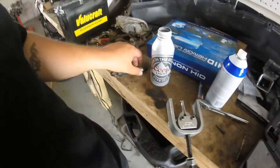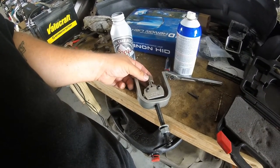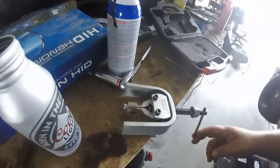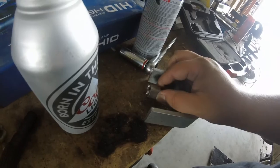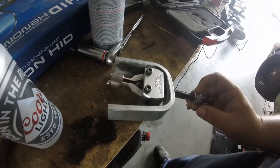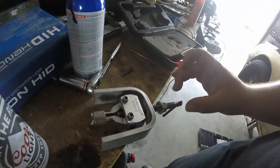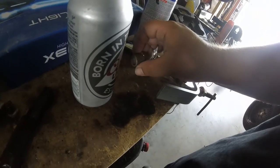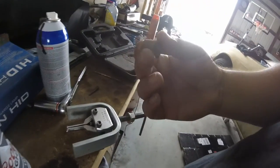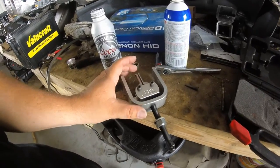Basically the way this tool works is it has these little claws that come together, and you insert it into the crankshaft where the pilot bearing is. It slides in inside and then you run this through until it's biting onto it. Then you run down this nut and that gives you the puller action, and that's what pulls the whole thing out. Hopefully we get the bearing — I'm a little nervous because I've removed pilot bushings before in other cars like a Mustang and literally had to grind it out without any kind of puller.